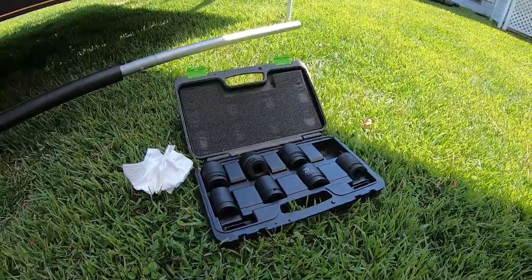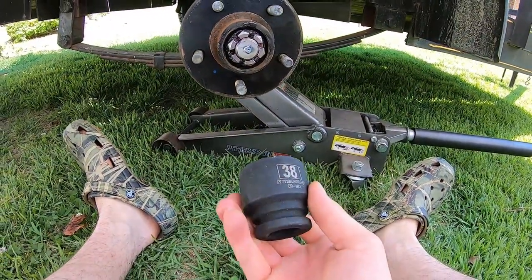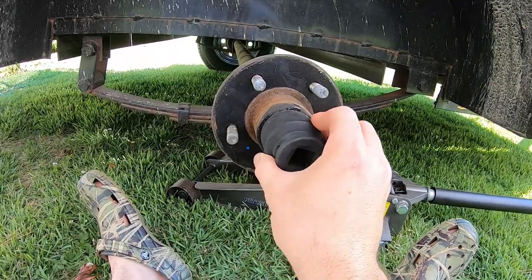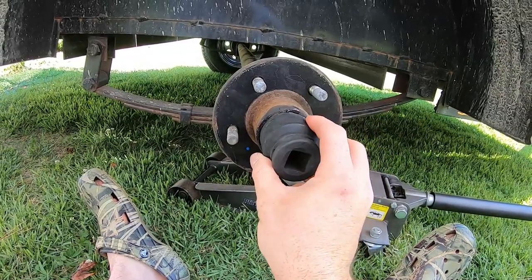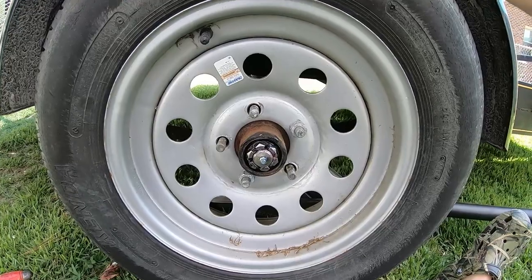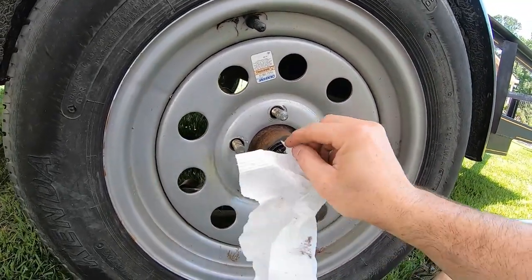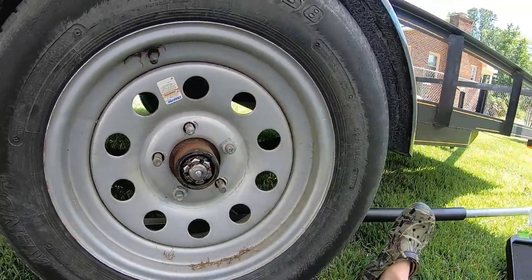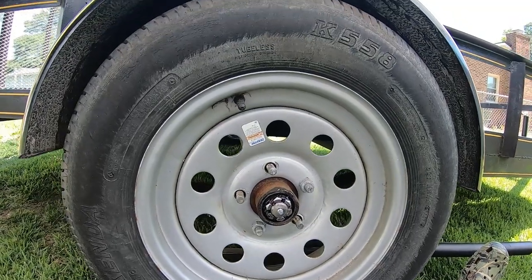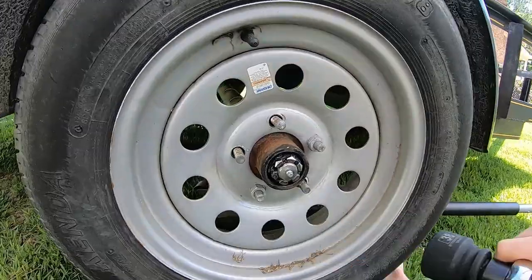Here's another little Harbor Freight special - the axle lug socket set. The largest one I've got is a 38 and the next size down is a 36 - and of course this would be a 37. But I can get a little bit of tightness on it with the 38. It's a little loose but I'm not hammering it in there - not going to round this off, but it gives me enough grip to tighten it down. This is basically my method for preloading these bearings - just by hand-tightening it, I lost the wobbleness that was in it. The nut isn't tight enough yet to stay, and it's still on the same hole the cotter key was in, so I need to try to make it to the next hole. Put your foot down to hold the tire and tighten it.